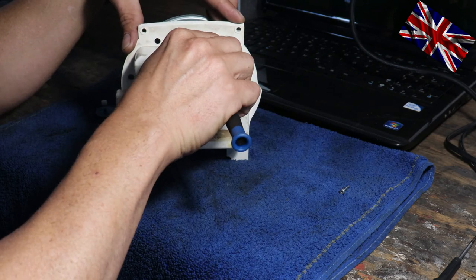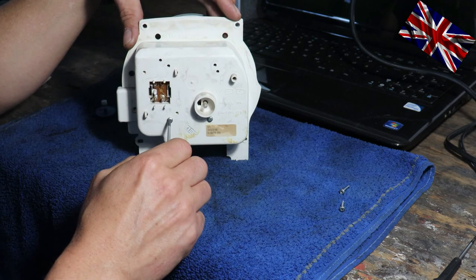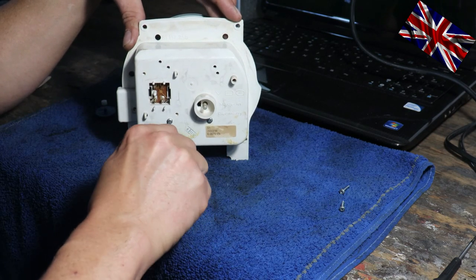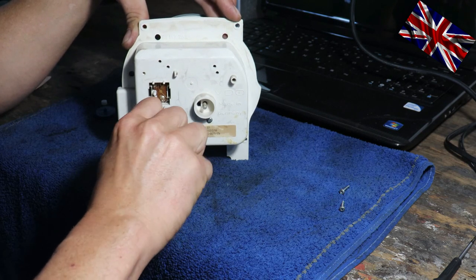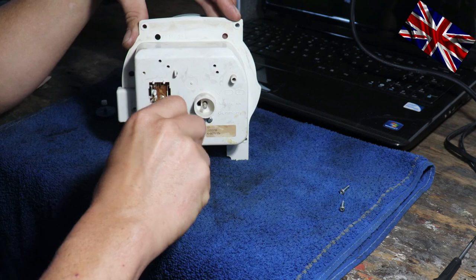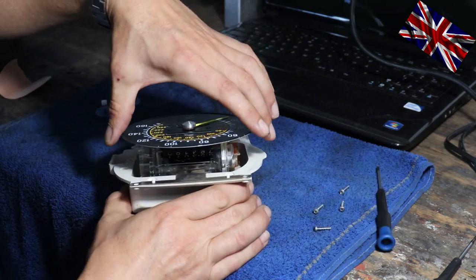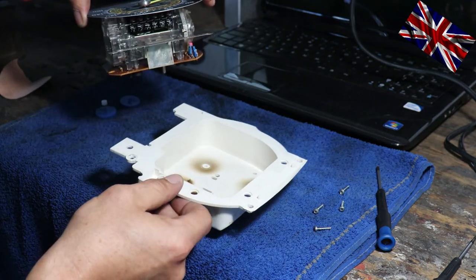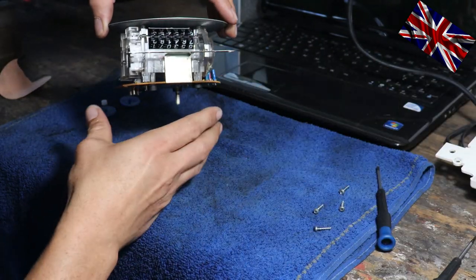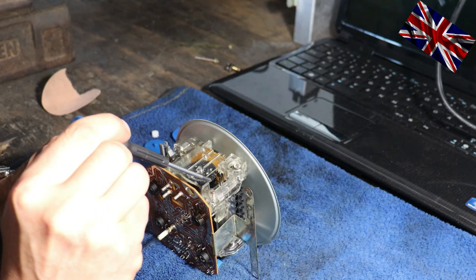Be careful and make sure that the hand, the needle, is not moving. It would be best to put the small finger of your left hand on the needle so it does not move. The other four fingers hold the assembly in place, actually a job for a watchmaker. Alright, all four screws are removed. Next step, put the housing on the table and slide out the assembly upwards.